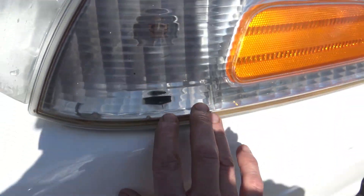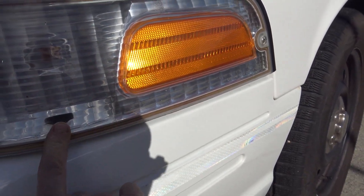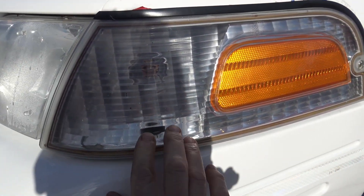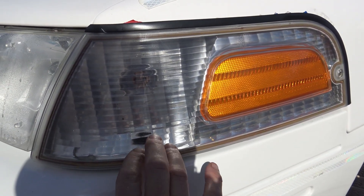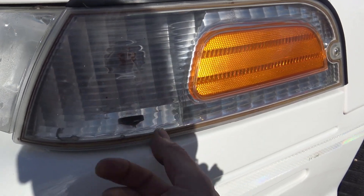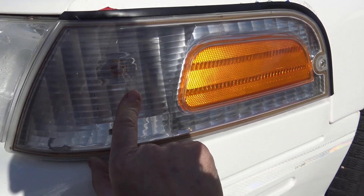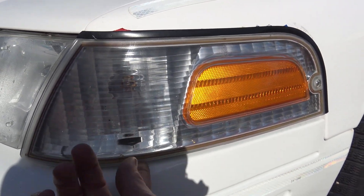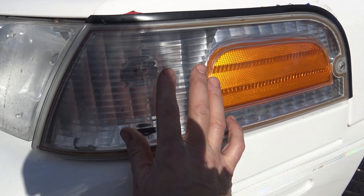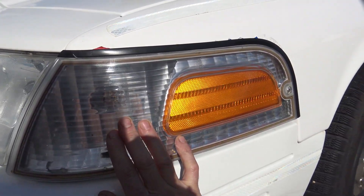Here's another tip. In the side marker lights — the signal lights on the side — there's a hole at the bottom on both sides, and this is where they had the police car strobe lights. They leave the hole, which is not very good because water can get inside eventually. So it's a good idea, once you get your Crown Vic, to seal that up with tape or something else so that water doesn't get inside and wreck these side turn signals.